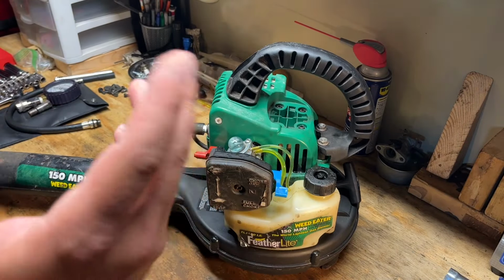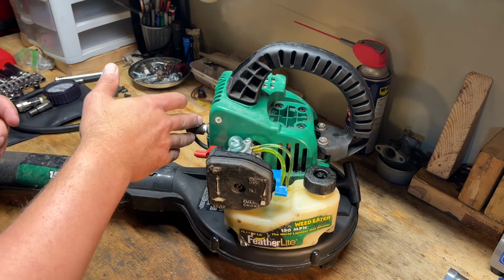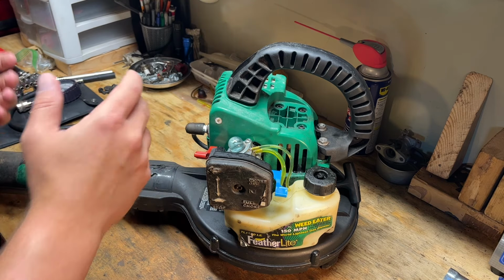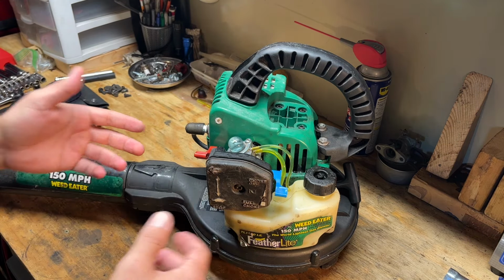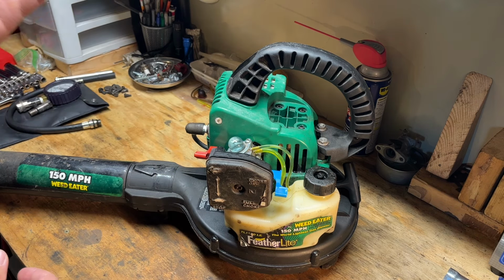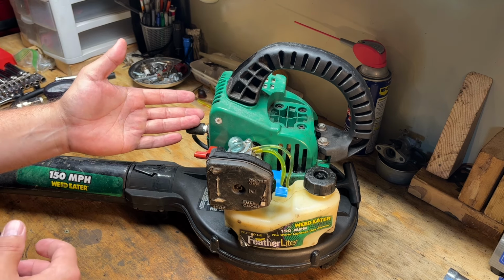Okay, well, it's story time. I spent enough time off camera trying to fool myself that the issue isn't anything other than that 70 PSI nail in the coffin compression reading. But I think that's the problem, and I think that's the reason it was put in storage, since that plug looked almost brand new when I pulled it originally. So my guess is they couldn't get it running. They swapped the plug as an easy try.